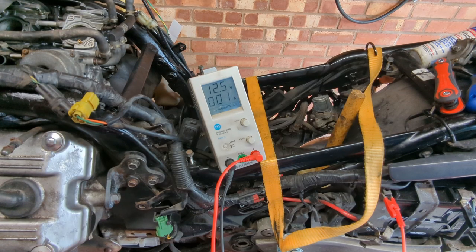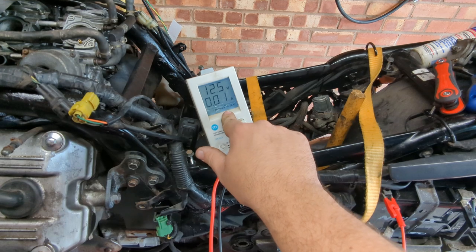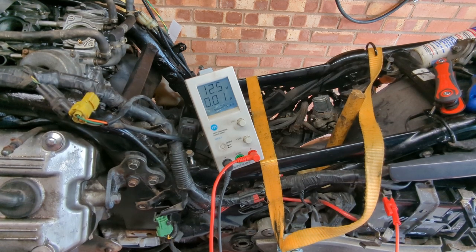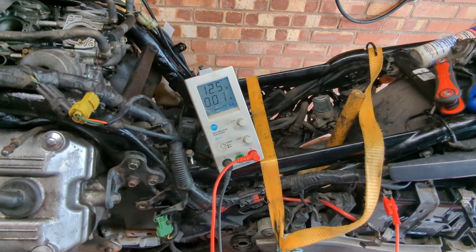Right, well, we've got this engine trying its hardest. It's probably a good idea to check the alternator works. Now, I have managed to misplace all of my multimeters, which is quite a feat, given that I actually have quite a few of the things. So we're going to do something plenty dodgy now, and that is, we've got the bench power supply, but if you look on its screen, it's not connected, so it's not outputting power. But if you set the voltage down, which I have to 10, and then clamp that onto the battery terminals, it's going to show the battery voltage, because this multimeter is half across the power supply inside, half across these terminals on the outside. So when we start the bike, we should see if it's going to charge the battery at all. But first, I've got to balance over the top of this mains power supply and pour petrol into that open pipe. Bear with me.